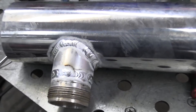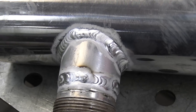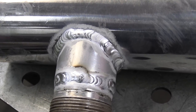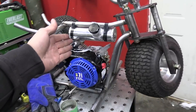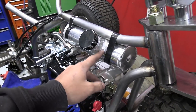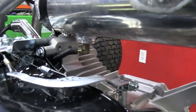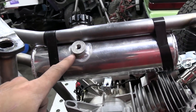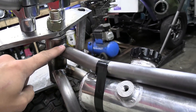I'm not sure why I always get so nervous welding aluminum, but it didn't come out too bad. We'll work on a little bit more consistency and a little less stop-and-go, but for the most part it'll hold. Without trying to bore you too much, this is the finished product: I welded the front and rear plates on, this is our fill neck on this side — I'm probably just going to hose clamp it to be honest — the feed is down here with a bung welded in the bottom, and the vent is on this side.